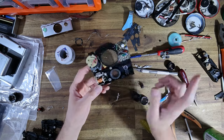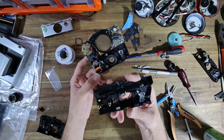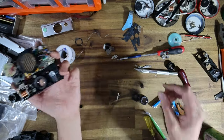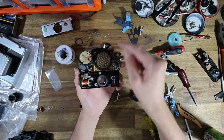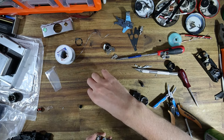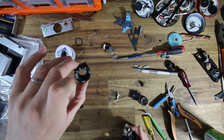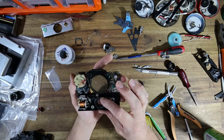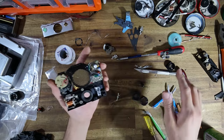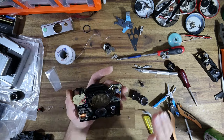Well, I ended up fixing the lens by actually just getting another shutter housing that would suit a sonar camera. I actually happened to have one spare from an SLR 680 of all cameras. I ended up taking out the original 680 blades, replacing the arm, I took the solenoid out, we swapped the whole bunch of parts over, because at the moment it is going to be a lot quicker for me to do that than have to wait for bits and pieces to arrive. I did toy with the idea of putting in a metal lens cell from a Model 2, but ultimately I've decided, do you know what, best to just keep it as original as possible. So I've used the lens cell from a 680, the front cell from the sonar, and what I'll need to do once it's all calibrated is just refix down the infinity label at the correct distance.